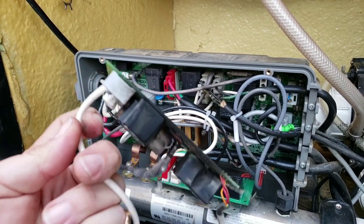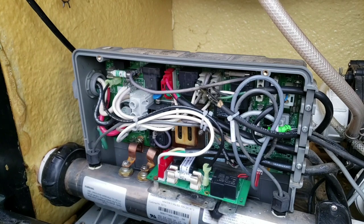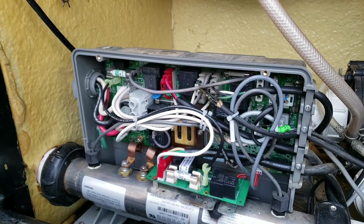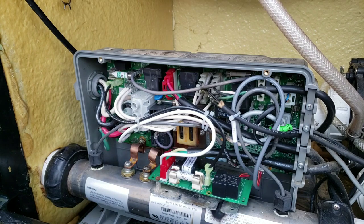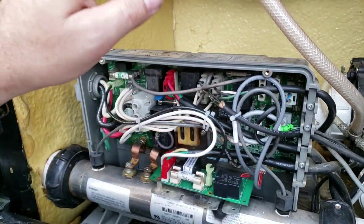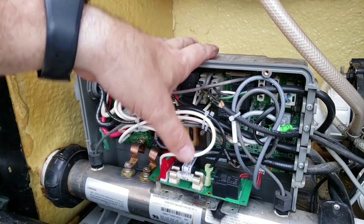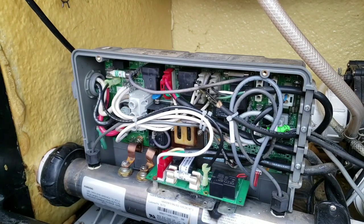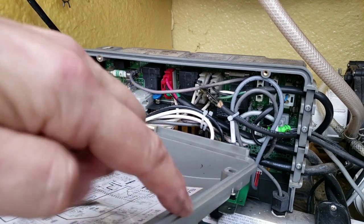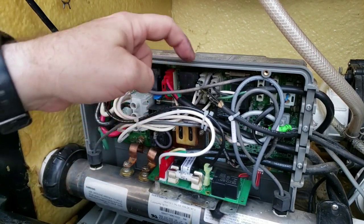You can see the board that came out of here — it's pretty cooked, and I'm going to give you the reason why. This is the second time this has happened on this Balboa setup. I think there should be a gasket at this edge. What I'm guessing is happening is water is coming from somewhere — it's splashing and coming down onto this housing, leaking through this edge and dripping straight down onto this board.